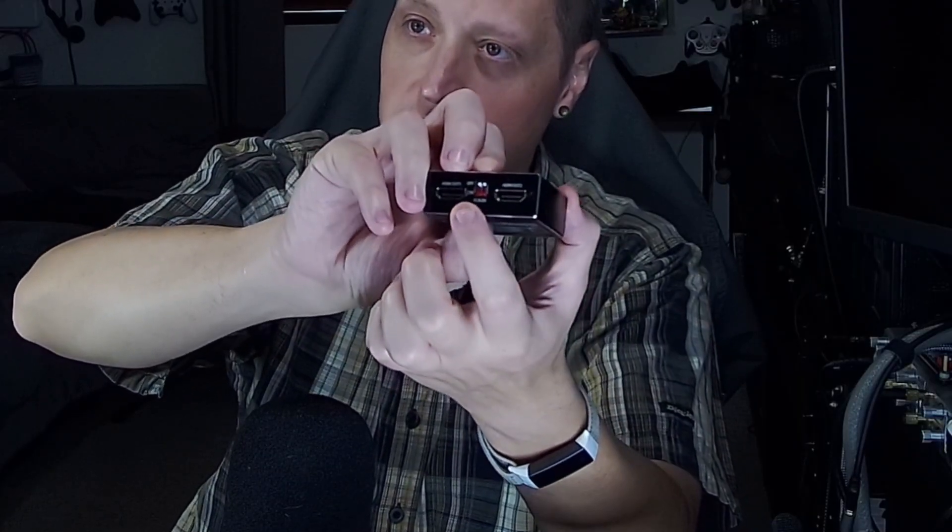So now let's talk about this HDMI splitter — I have three of these in my setup and I like these a lot. This one is in a plastic shell; it's not really robust, it feels pretty inexpensive, but it is discreet and pretty slim when you compare it to the EZCO. The EZCO is in a nice metal housing and feels like a much higher quality product. The EZCO is also powered by USB 5V — same deal between these two. But it has a toggle for different modes and EDID emulation: it has 4K, 2K, and copy one modes. This will also do 4K to 1080p downscaling. You'll notice there are two little dip switches that you can toggle up and down, which allow you to turn the scaler on and off independently for each output — which is really nice.